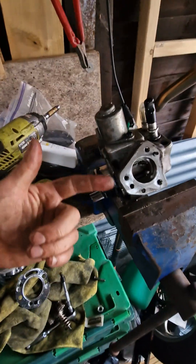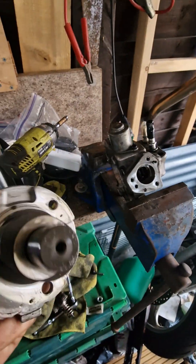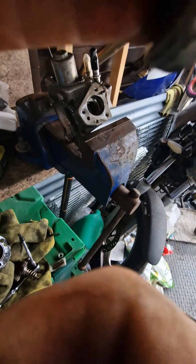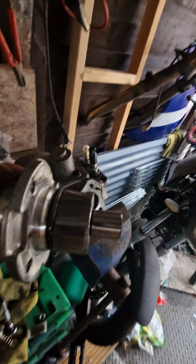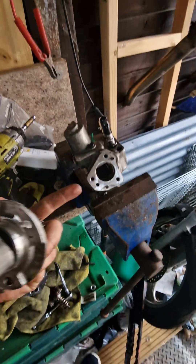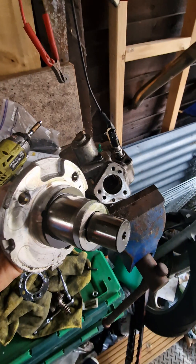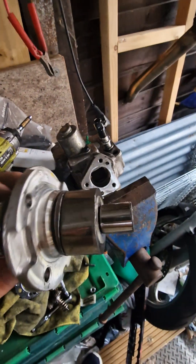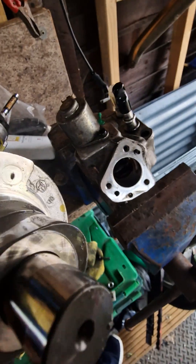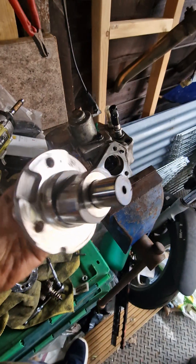The second issue: you've got the cam inside, which is this bit here. This is the most common fault that happens, other than the spring. The hard chroming on the outside of the cam — because this cam spins at high speed, touching the pump and producing the fuel flow — that hard chroming wears out. Once it's gone, it starts eating at the softer metal underneath, and that causes metal filings that will clog up your injectors. Those injectors are about £150 each from Ford.